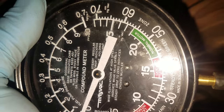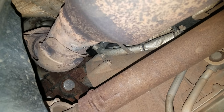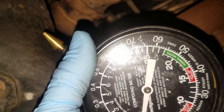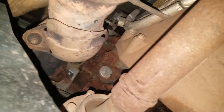That shot up all the way over 10 psi on the stopped-up cat. With a good cat, you should be one psi or less, or one and a half — somewhere in there. But we're not even close to that. You've seen how the passenger side barely moved and how the driver's side definitely went up over 10. If you rev it up really high, it would peg out the meter.